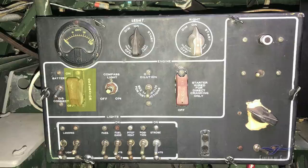To the right of that is the generator switch. The generator doesn't come on line until about 1,500 RPM, then you'll see the ammeter pop up. You'd check that during your run-up. To the right of that is the oil dilution switch — in really cold conditions, like Alaska or Siberia, you'd reference a chart in the manual and flick that switch to take fuel from the fuel tank and put it into the oil system to dilute the oil so it's not too thick for the next cold start. Our airplane's probably not connected right now.